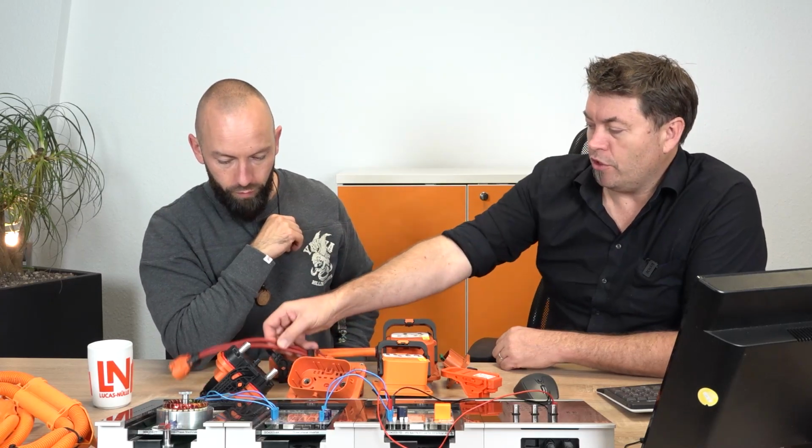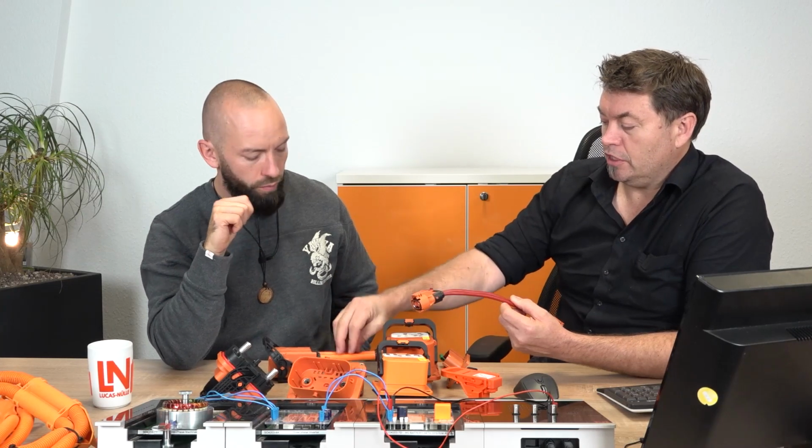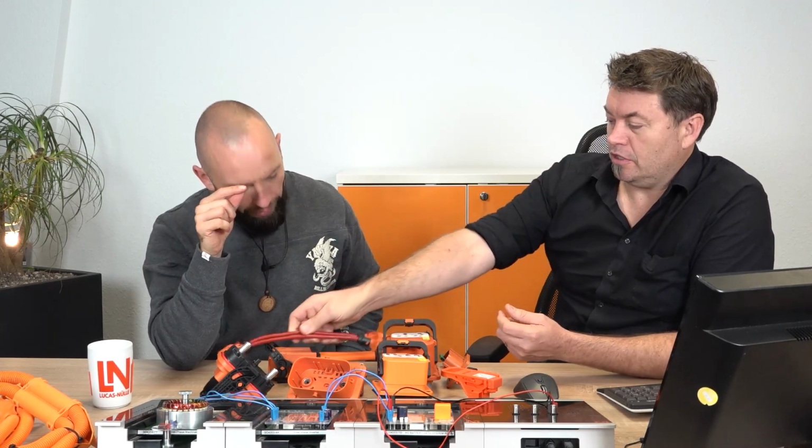You often have a lot of motor generators. So Toyota, for example, they have the buck boost converter that increases the voltage. The traction motor voltage will go up to 700 volts. So you have a different voltage between the battery and the electric motor. Exactly. But if it's running at a lower voltage, then you need bigger cables. I see. So it comes down to essentially the philosophy and strategy of the manufacturer.